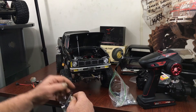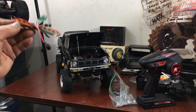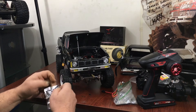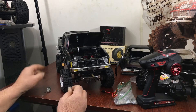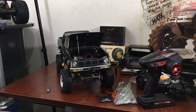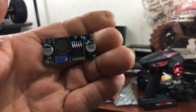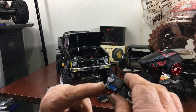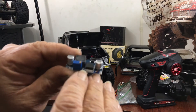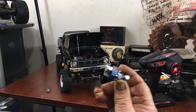You can buy the one for the kit when you buy it from Engine DIY or Sterling Kit — those are about $15 to run the glow plugs and you need one for each one. Some say you can tap off another plug and run two, and I've tried that — you can run two off one, but they get hot, especially if you're running longer leads. So I found these online: this is a tiny voltage reducer, I think it's 12 volts in and you can turn it down to 1.5 volts.